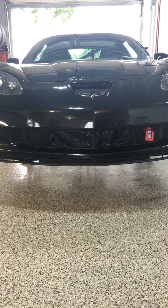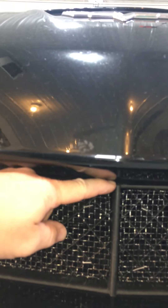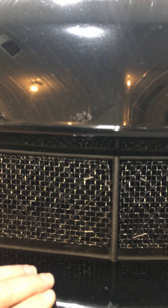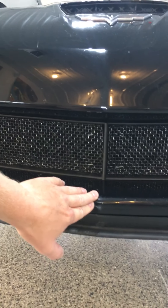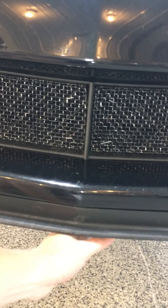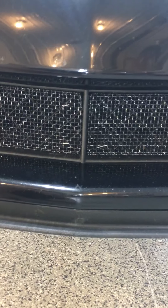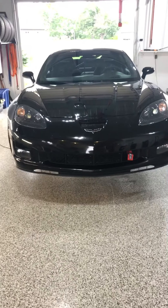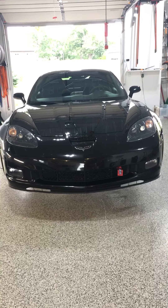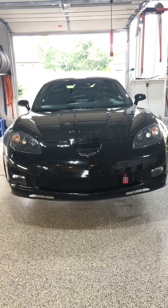Next is the front reinforcement. The bumper is starting to get the 'smiley face' as they say — sagging down. It's not necessarily from hitting curbs but from sustained high speed. You can see a gap right in here; it's starting to hang down, and when you go pretty fast it pushes down further. You can see how much play and deflection there is. A ZR1 bumper reinforcement will push this up and hold it there. Road America and BIR are pretty fast tracks, and this car could use a little more rigidity in the front.